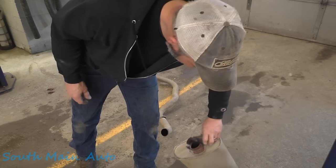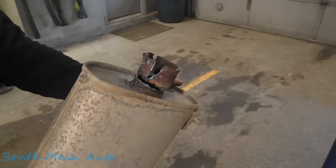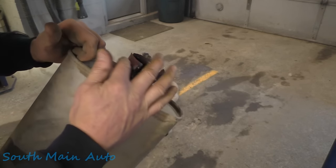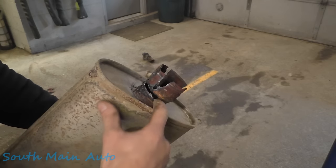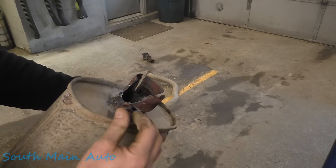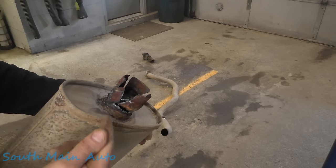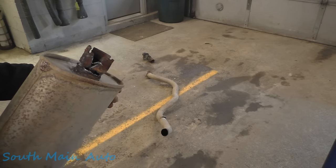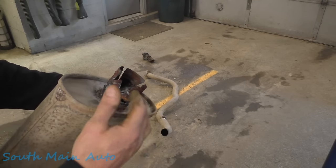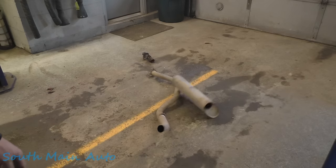The big difference between chopping this off with your Sawzall, which is obviously the best way to go, faster, stronger, better, is when you use a torch, you get it all in one shot. So I cut the clamp, cut that off, and then I'll just nick the pipe in several spots with the torch, and then just cut around it, and then that's when the muffler swung down and hit the ground. And when you do this, if you're comfortable with your torch and you know how to use it, you can cut these slots in it and you never hit the underlying pipe. And that's why this is far more superior than the Sawzall will ever be, because once I cut the muffler off, I'm ready to put the new one on. I don't have to get up there with a die grinder, chisel, outside cutter bit on the air hammer. It's off and it's ready to go. So that's why a torch is better than your Sawzall.